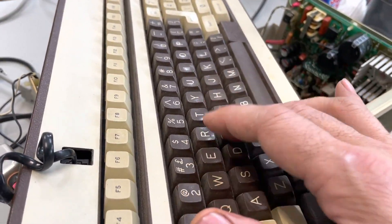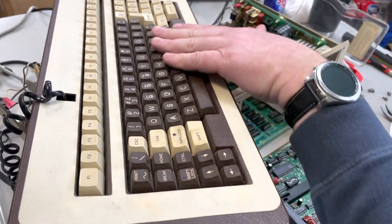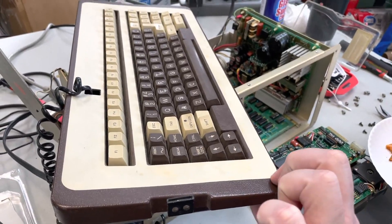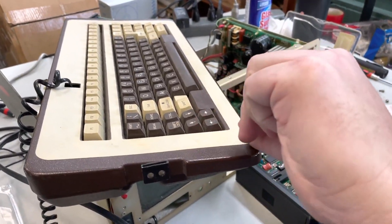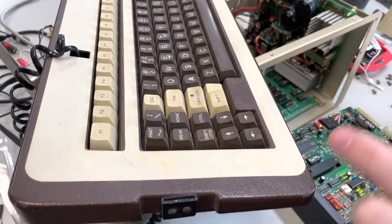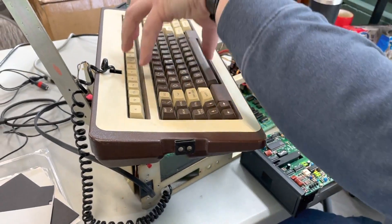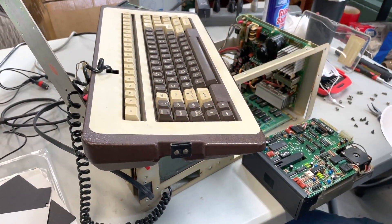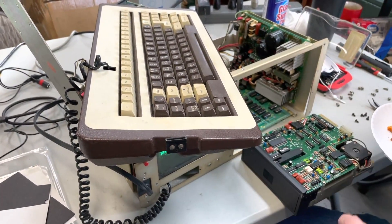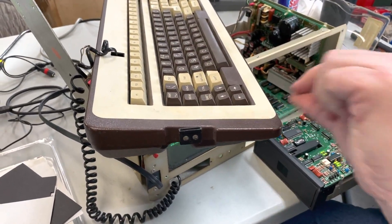It's not a bad keyboard — not a bad keyboard at all. But these are kind of a pain if you ever had to replace or work on these keys. You actually have to peel up this bezel; it's stuck on it. You have to peel up that bezel to get to — it's like a big glued sheet. And apparently the technical manual says do this — you have to peel this away to get to the four holes for the screws that hold this keyboard on. But if you want to get anywhere working on these keys, you have to mess this up.